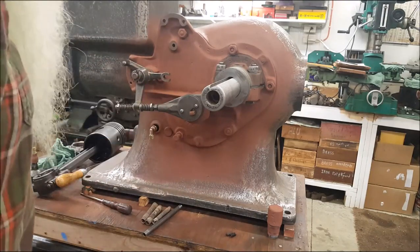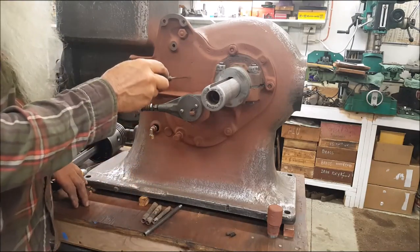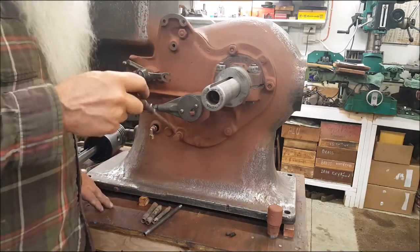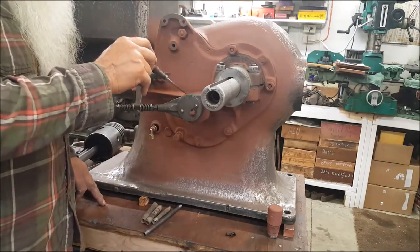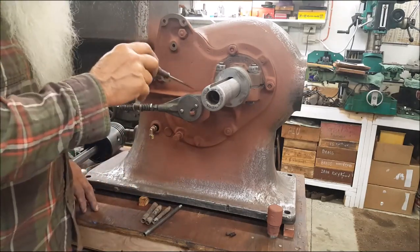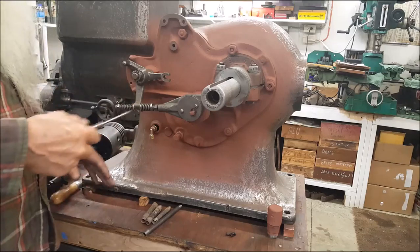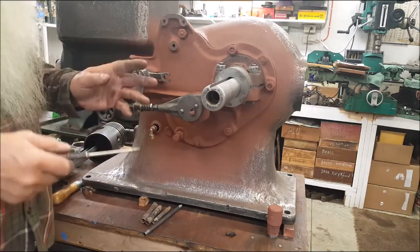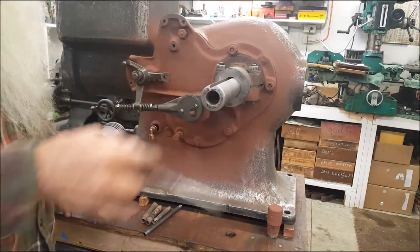There is going to be some cost in this thing. This side cover right here — and this camshaft — the tolerance on it was, like I say, the best I have ever seen. There was no wear on the shaft, less than half a thousandth wear on it, and the housing itself had no wear either, like it came from the factory. The one that was on here was worn out to a condition where you could have run the engine but it would have been real noisy. Running a loose bushing like that just telescopes the wear over the whole complete engine — everything goes out of alignment — so it would have had to be repaired to run the engine if you were going to power something with it.